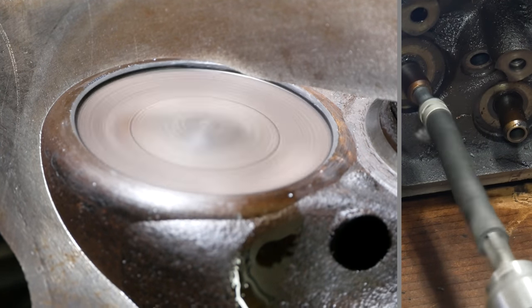While going through this process for both cylinder heads, I wanted to make sure to get some nice before and after shots of the same valve. It only makes sense to use my favorite subject — the intake valve from cylinder number 3. Here it is before any valve lapping at all. The surface is very badly pitted all the way around its perimeter. There isn't a single smooth area on the valve face. The seat doesn't look nearly as bad, but it's certainly not looking good either. You can just barely make out the machining lines in it, and there aren't any huge chunks missing or anything, but it has certainly seen better days.